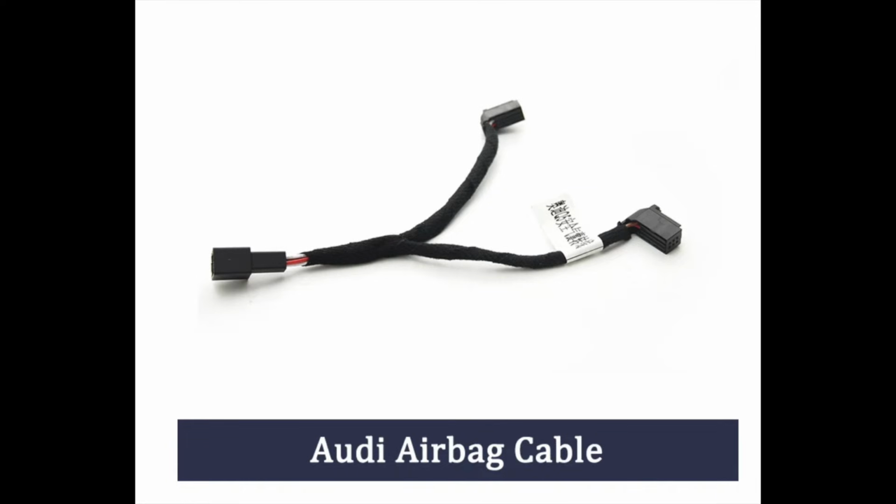So you're going to want to take that button off of the old bezel, and I kind of shaved it down with some pliers, but you can use a Dremel to make it as slim as possible, and push it back where the GPS and the 4G antenna are. I was able to get it to fit in there. And then make sure that with your airbag harness, the plug side with more than 2 wires is going into the factory button, and the 2 wires are leading to the front of the dash.